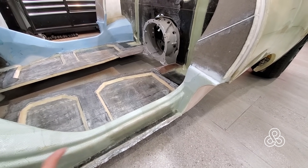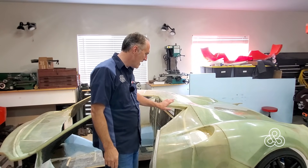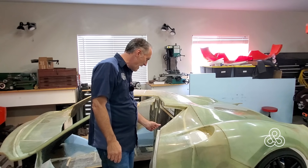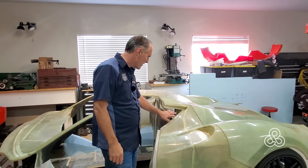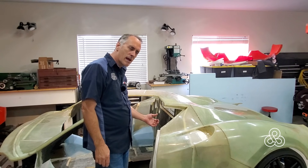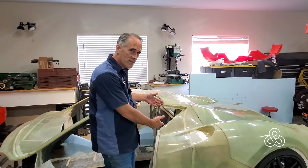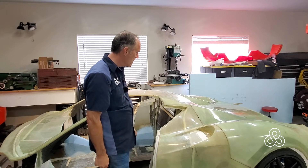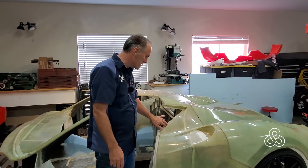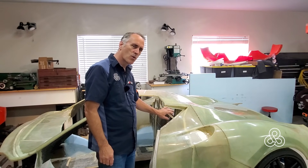Since I'm using the tunnel, I have one of these really narrow door seals so that when my wife gets in with a dress, she doesn't have to reveal to the world. Now coming up, we have this little quarter window. This is going to require us to build in a little piece that comes through here and has our flashing for the weather seal to attach to it, and then the glass will get bonded in. Now that I realized it, it would have been a little bit easier just to have created this little piece as part of the door itself — we could have had that whole piece of glass combined with the door. The weather stripping would have been a little bit easier to come back through this whole system. Just a little bit different approach, but probably would have been a little bit easier to attach that to the door rather than make it a separate piece.